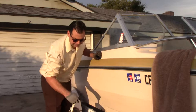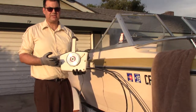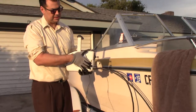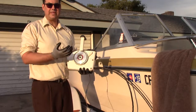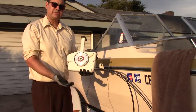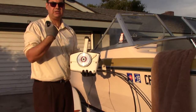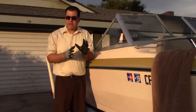What is the fast idle and the choke? I have a control box right here — this one is for an Evinrude, but they're all pretty much the same thing. The fast idle is basically a lever that you just raise up, and it pulls on the throttle without putting it in gear. This makes it spin a little faster to help it start up a little bit easier.